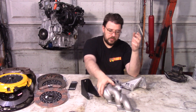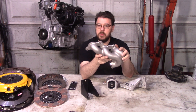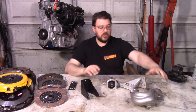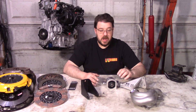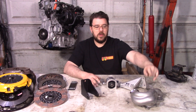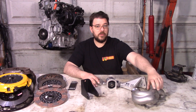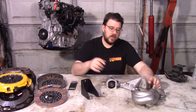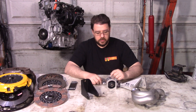First thing I want to talk about — let's talk about the 2GR. I've mentioned these before, but they are now shipping. It's been a long delay and I sincerely apologize for that, but I now have these in stock. I do have a reasonable amount of stock, so they should be available for quite some time. These will make it so now in the first gen as well as the third gen MR2, they are much much closer to the block and will help swaps. Now, for other people doing 2GRs that are not in an MR2, if you have an engine-driven hydraulic power steering pump, this will not fit — it'll hit right here. Also, this does not get in the way of the oil cooler, but it does get in the way of the oil cooler's coolant lines. So you're going to have some coolant lines that are in the way that you'll have to reroute. You'll still be able to use your oil cooler, but you'll have to reroute the cooling lines. The actual oil lines themselves will be fine, and the location of the oil cooler itself will also be fine.